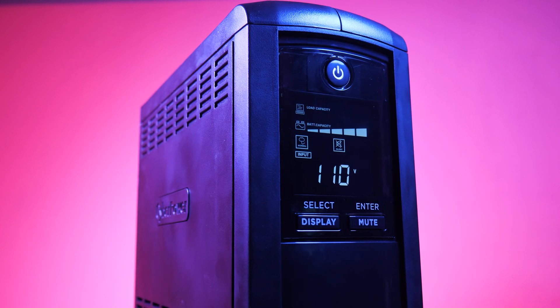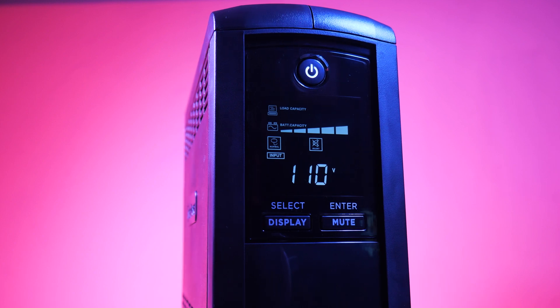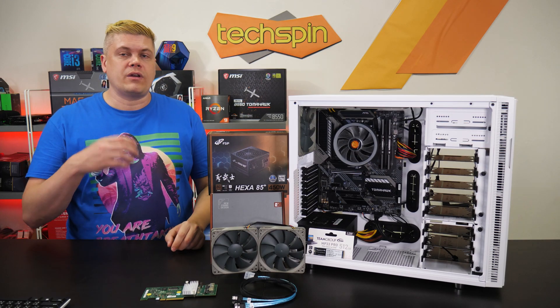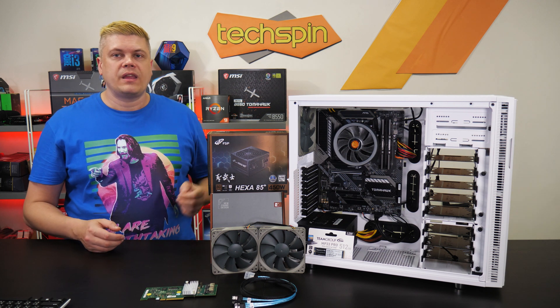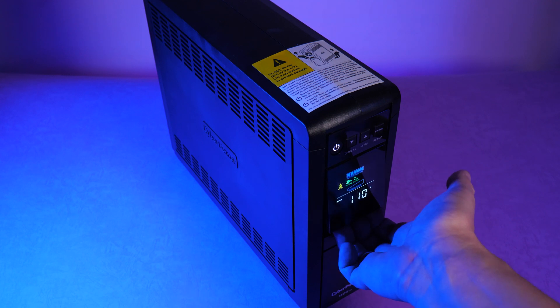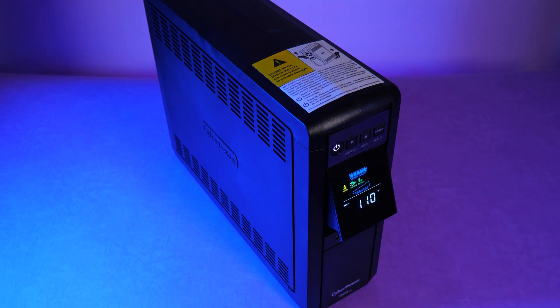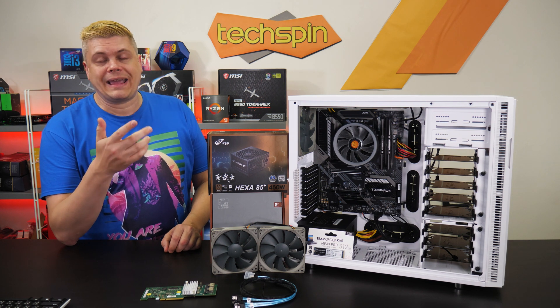All this equipment is unprotected from blackouts or power surges. We did an episode with CyberPower about what to look for in a UPS — link up here — and you should get one right after setup and testing. If your drives survive a power surge, parity rebuilds can still take 12 to 14 hours per 4 terabytes. If you're serious about a NAS, you'll need to be serious about backing it up too.